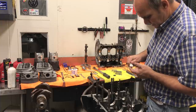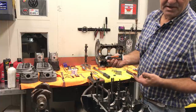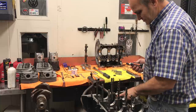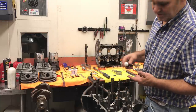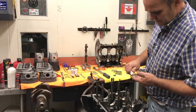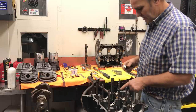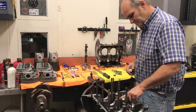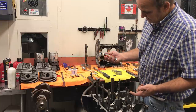A little cam lube is provided in the cam when you buy a Scat camshaft — most cam manufacturers have lube. I always clean the lifters off really good before I put this on so it sticks good to the lifter. If you've got any kind of oil on the lifter, this stuff can slide off. This is good stuff, it's really sticky.